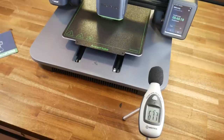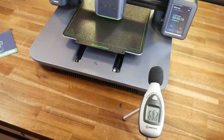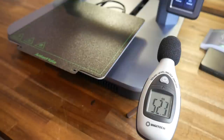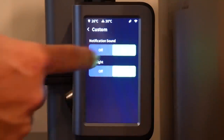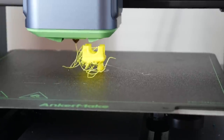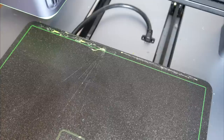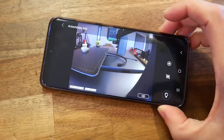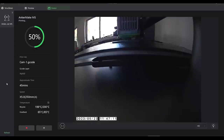One thing that's really not so good is the noise — during printing with all fans on it is quite obnoxious. And annoyingly, even when the machine is idle, there are always fans spinning that aren't exactly quiet. At least the touchscreen beep can easily be turned off. The AI detection could definitely use some work, and all the stopping and starting during first layer checks makes for quite a lot of cleanup post-printing. A lot of those wisps end up finding their way into cavities, so users will need to be diligent. The camera angle isn't really ideal for monitoring print progress, and Anker doesn't exactly have the best reputation when it comes to handling users' data.